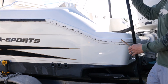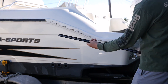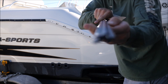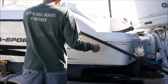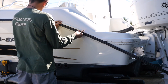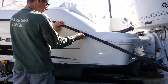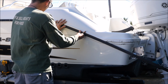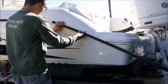We're at the transom. Here's my six-foot piece of plastic under-skeleton. As you can see, the lip on the outside is more pronounced than the top side — that lip always goes to the bottom side of your cap. Now this area is contoured and has a curve to it, so the rub rail skeleton isn't pliable enough to make that curve in one piece. You need to take small turns, piecing it together with small cuts, turning very slowly.